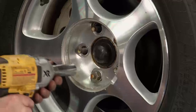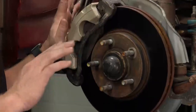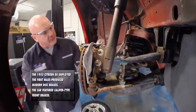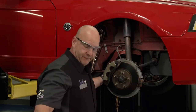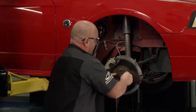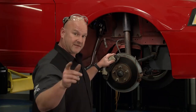I've got three lug nuts off here, let me get these other two so we can get a good look. Typical good visual inspection - you're looking for any kind of leaks on the brake line, nothing dripping, no evidence, no tracks. This hub is really hard to spin. So this caliper - a pad either inboard or outboard is sticking. I'm going to take this caliper mounting bracket off - it's a 15 millimeter on the back on this Mustang. Working it loose to relieve that pressure, essentially overcoming that back piston. And that's spinning a little bit better. I'm going to go ahead and get the caliper off - probably end up replacing this, or you may want to rebuild it.